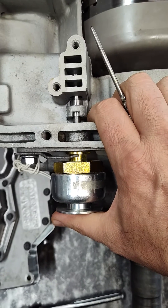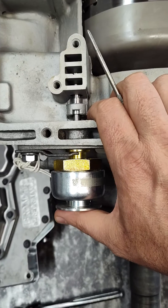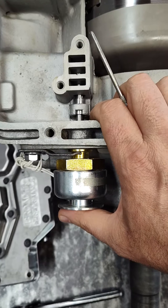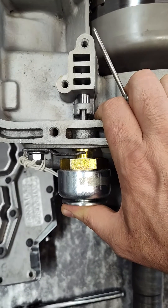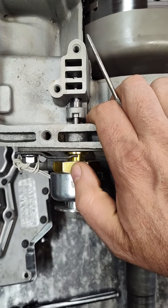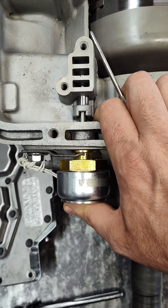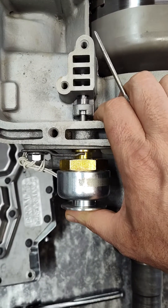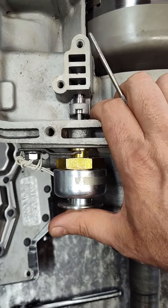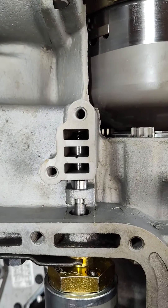When you gas it, or even any time you have hydraulic load, it's just gonna push this off. Another thing to check: if you have a situation where the trans brake doesn't seem to hold well, if you can get this on a lift or use a camera underneath the car, look and see if this is actually getting pushed off hydraulically. Sometimes these can get weak, or it's a situation where you're not able to clamp it all the way and hydraulic pressure actually pushes this off.